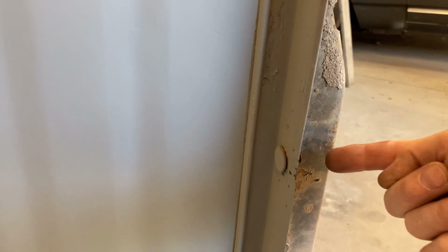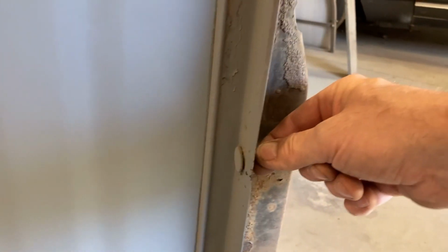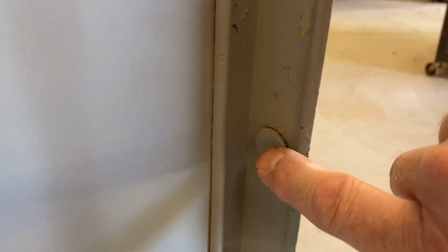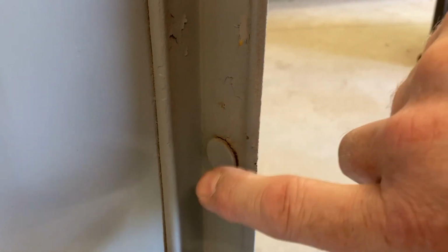These bolts that hold the bed floor in, I thought you could just punch them through the back and knock them out. For whatever reason, I was thinking they were splined, I think because of the replacement parts, but they're not. They're actually spot welded in like three places, the head of this to the bed rail. So it's a little bit of a problem knocking those out.